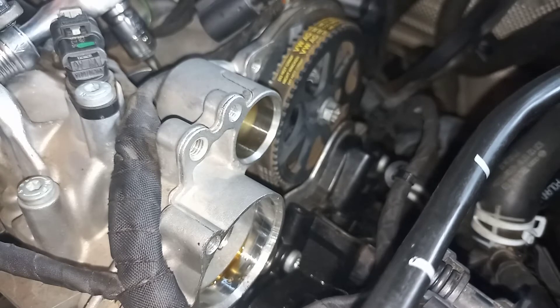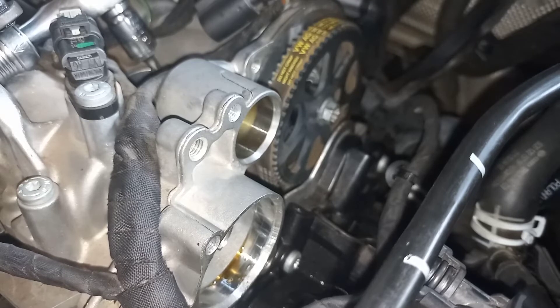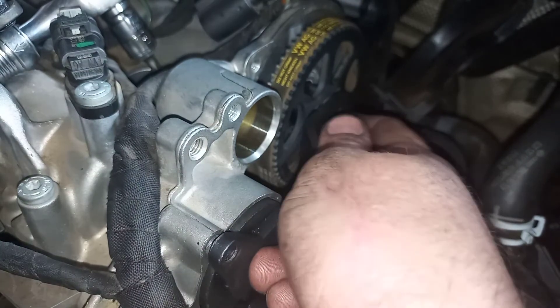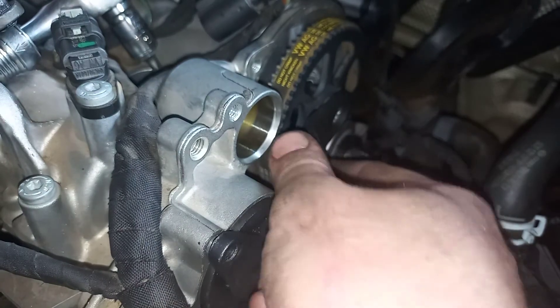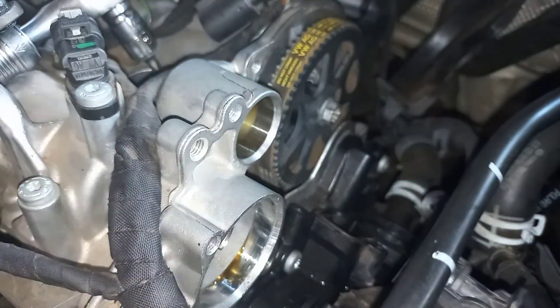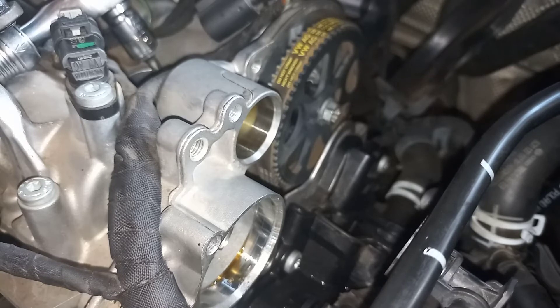That's the long and the short of it. Let me see — I just want to give it one more chance to see how close I can get it to true TDC. The timing on this is very, very precise — you do not want to eyeball this. See, it doesn't slot in, with all the wiggling and jiggling it just does not go in. So guys, you're going to need the proper timing tools on this — you cannot eye this, it's not possible.